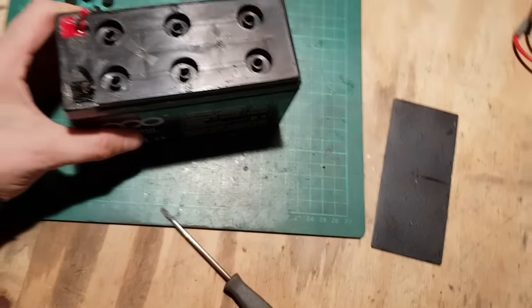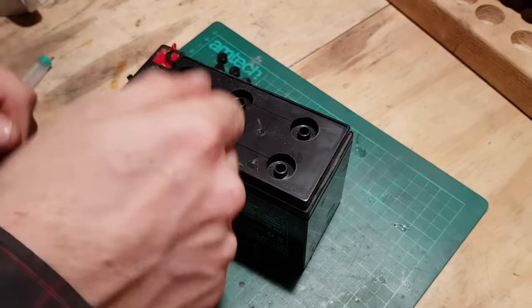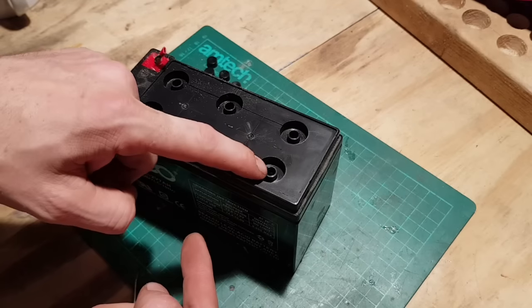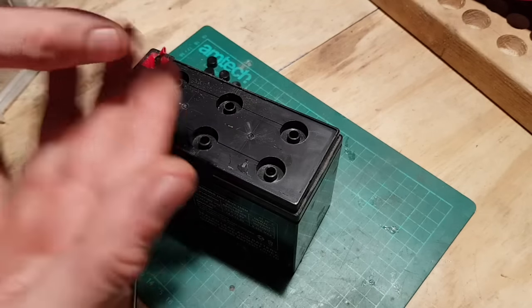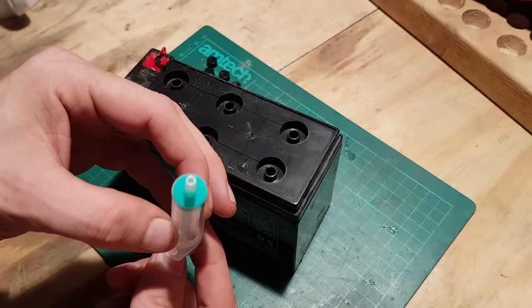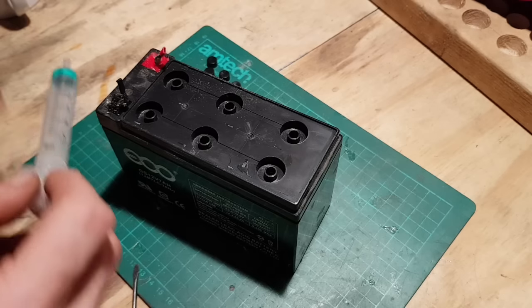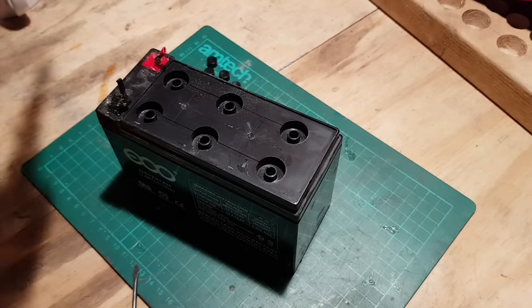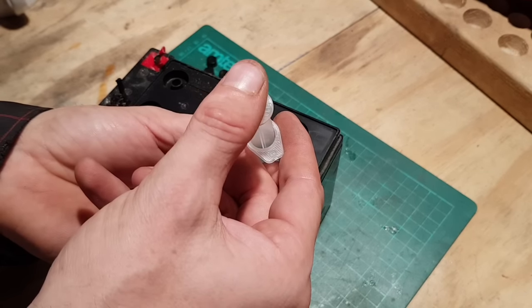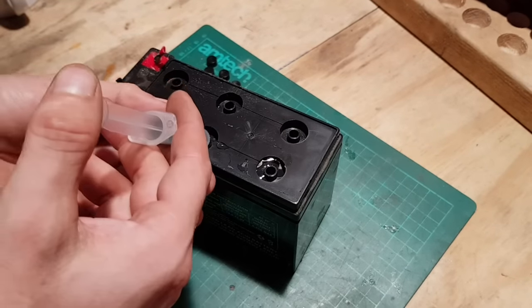You can see the heads of the cells, and they need to be covered in water. Sometimes if you're just pouring it in by other means, air bubbles can form and stop the water from going down — it might let you think it's full. That's why I use one of these little medicine syringes. This bit helps poke down past the hole and fill the cell up quicker. Just place it in and do that to them all.